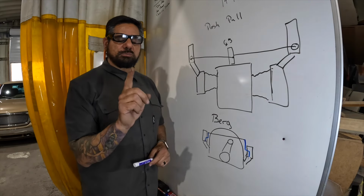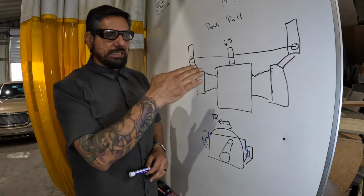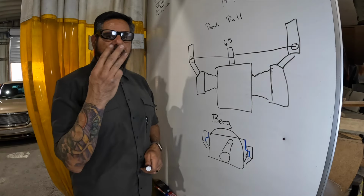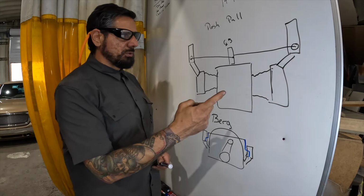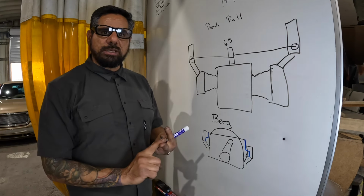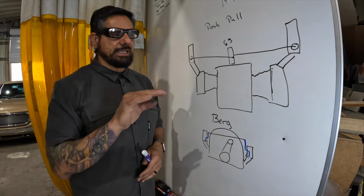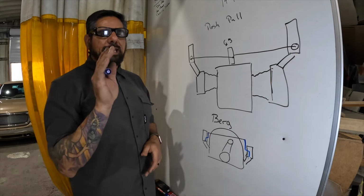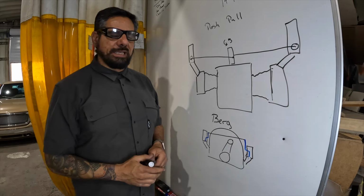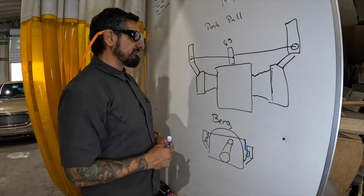There is one push-pull on the market that I do like, and it is the Vintage Speed. They've corrected the issue that we have here. I have three buses on the road that have push-pull linkages on them: my brother Bill's Bull Run bus, his carbon cab, and Scott Moses' bus. All of those were on push-pull because they were Porsche shrouded type 4s. And every time we go on a road trip with them, they have idling issues when their motor starts to get warm. And there's a reason for that.